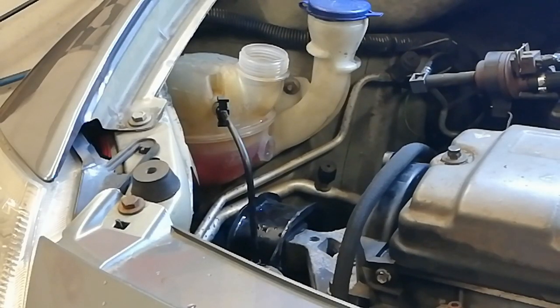The level has now dropped to about the minimum mark. I'll top it up to the maximum, pour a little in, put the pressure cap back on and take it for a drive. What I do is take it for a good drive, get it all circulating, then let it cool down — you'll often find the level drops further once it cools. Make sure you have the heater on hot with the fan on speed one or two so the coolant circulates through the heater matrix inside the car.